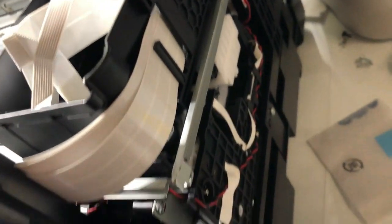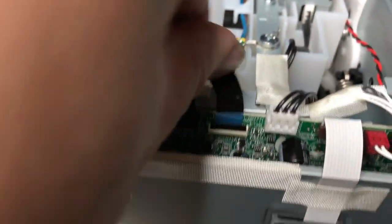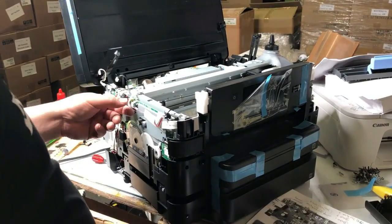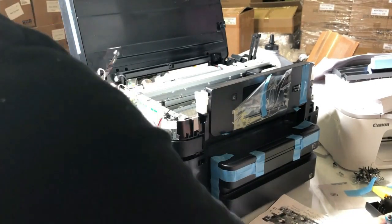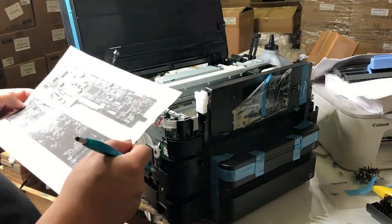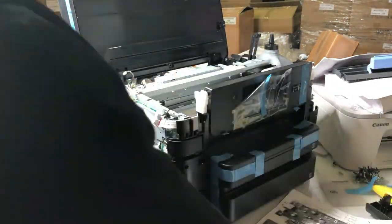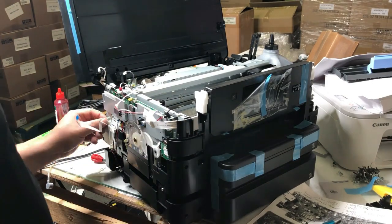First, take your phone and take as many pictures as possible, because we're going to start pulling the wires away. What's also helpful is to get a picture of the motherboard and write down the connections and their locations. This is how I work — I have a picture first, then I write down the color of the wire, then I do a bracket and inside I write the connection color. If you don't want to do your homework and want a cheat sheet, go to bchtechnologies.com and put your printer model in to see if I have a cheat sheet or motherboard flowchart — you can download it for about a dollar.